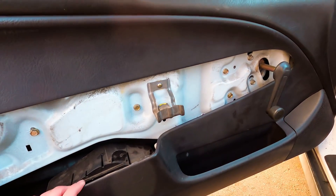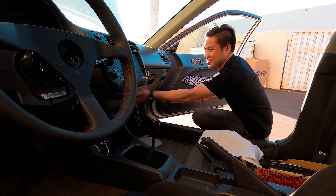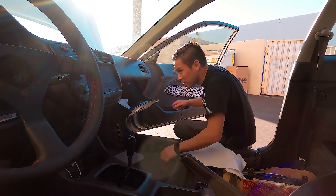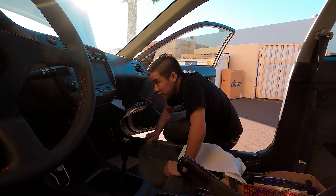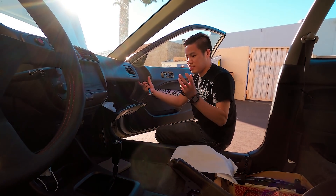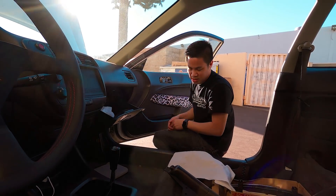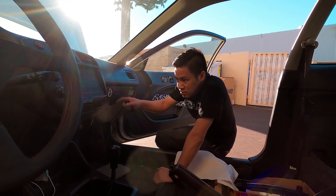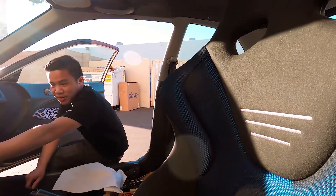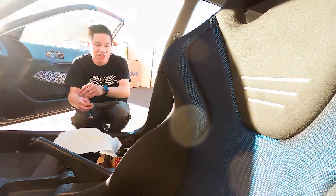This is fun. When I was driving home it's just like — this fucking leopard print door thing — and there's like a motor mount in here. Why is there a mount in there? It's the rear motor mount. Oh, yeah — the rear is the hardest one to get to. The transmission mount and driver's side head mount are easy, but then the rear you always have to lift the t-bracket.